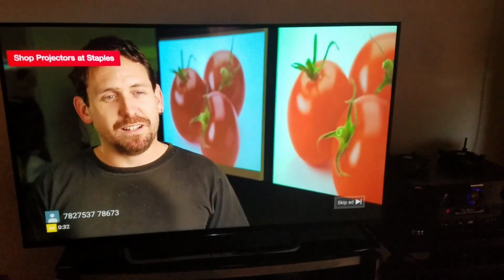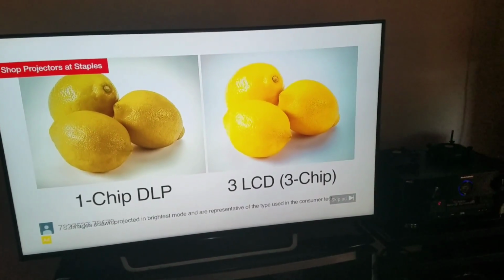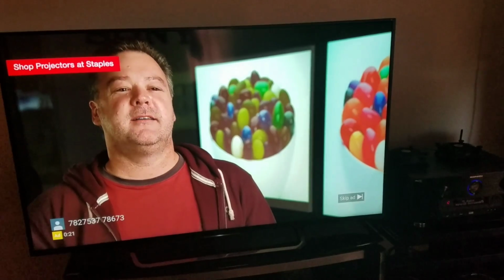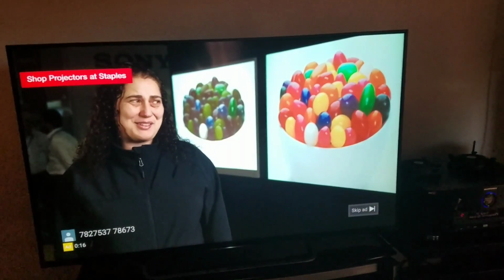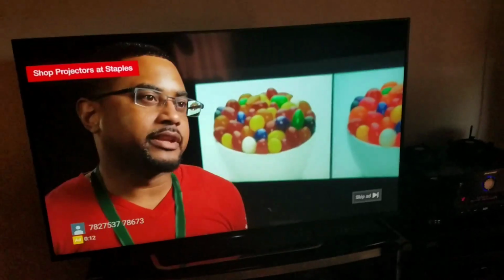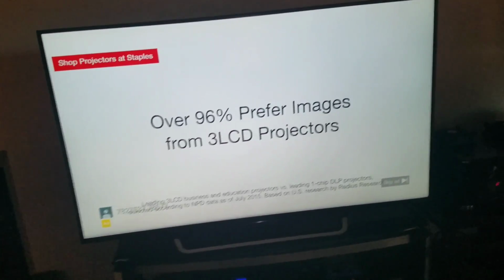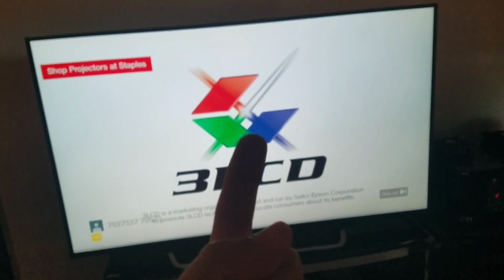And let me just quickly tell you, you must have every piece in the chain, every link in the chain, so to speak, must be Dolby Vision compatible. You don't need to necessarily see that Dolby Vision symbol or indication on every piece of equipment, but you almost do. So let me just quickly tell you, we'll move on here. In order to activate Dolby Vision, you must have everything Dolby Vision compliant, meaning at least your display. Your display absolutely is the most important thing to be Dolby Vision compatible.